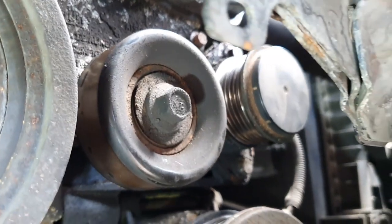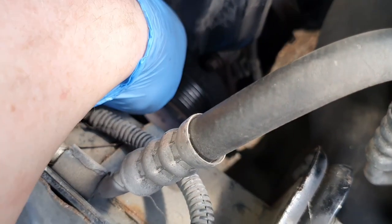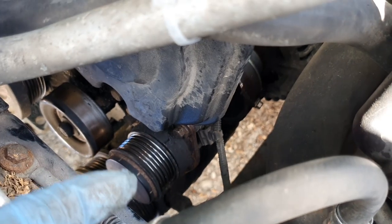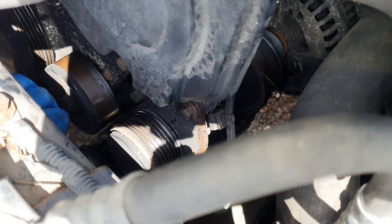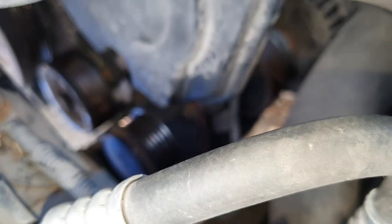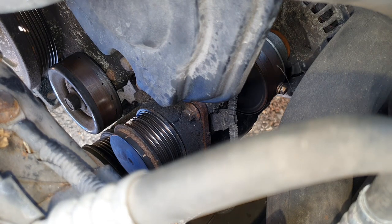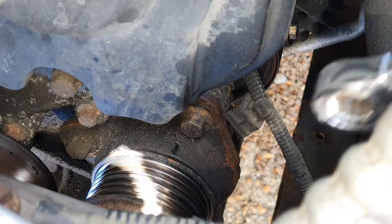Back at the top of the car — you're looking for this pulley here, which is the decoupler that links to the alternator. It's held in by two 10mm bolts, one just there and one just below which you can get from underneath. I'm going to set the camera up and get these two bolts out. I need to relocate the camera — it's right in the way — so I'll use a 10mm ratchet spanner.